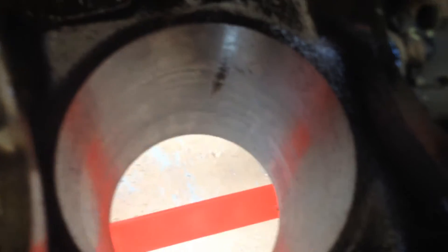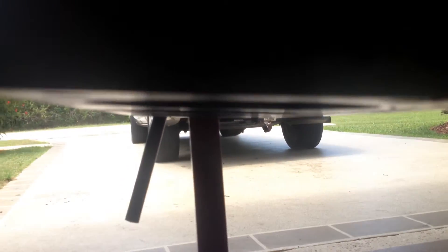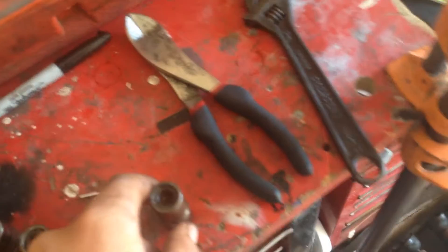But for the most part you can see down in the cylinders they're not looking too bad. The lifter valleys, and right now there's no bearings in it, but you can see she's pretty well straight. Here's the top side — you can look right down that and it's pretty straight. And here's the lifters. This does have a flat tappet cam in it.